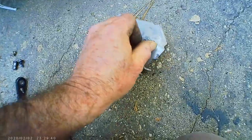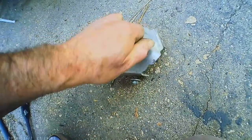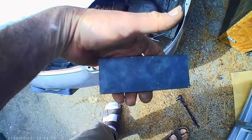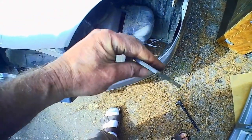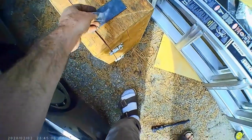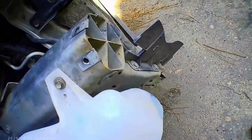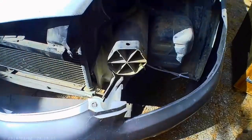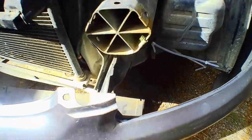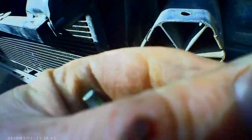I mistakenly thought the bolts weren't strong enough, so I took off the end caps and used a 2-inch by 3/16 flat bar, around 4 inches long. And the welding tabs that wrought iron workers use — they're 1/8-inch. I cut them a little bit shorter than shown in the picture, but I took the nut and put it through the clip nut on the hexagonal frame rail that's protruding from the frame rail.